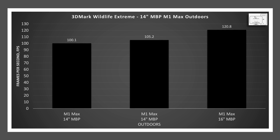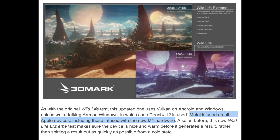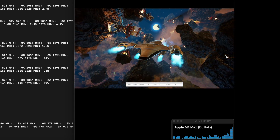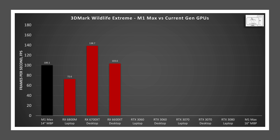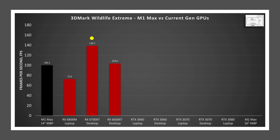With the variation between the M1 Max in the 14-inch versus the 16-inch MacBook Pro, I started to wonder what variation you see from AMD and Nvidia when they have the same GPU die in a laptop and a desktop. Since 3D Mark Wildlife is a native application for Apple Silicon, I pulled together a performance comparison of AMD and Nvidia GPUs to understand performance variations between constrained laptop operation and unconstrained desktop operation. Starting with AMD: the RX 6800M laptop GPU is 27% slower, and the RX 6700 XT desktop — using the same Navi 22 die as the 6800M — is 38% faster, which really highlights the performance limitations of AMD's laptop GPUs.